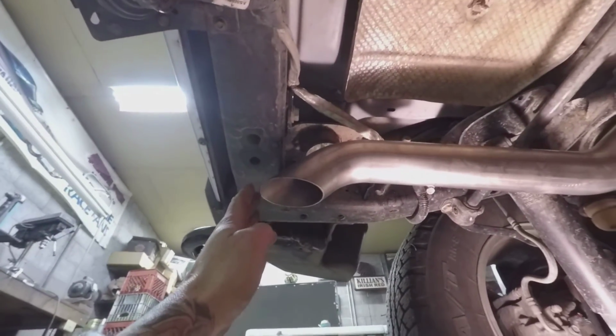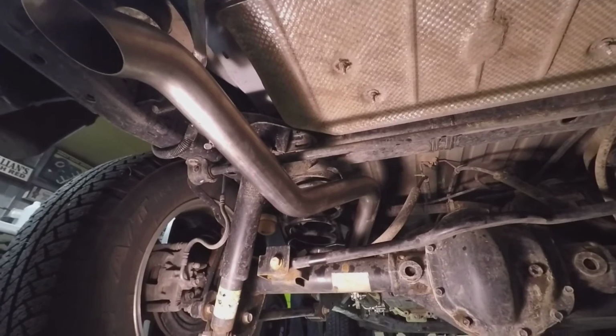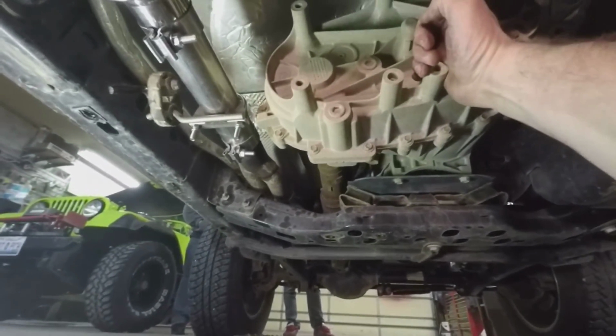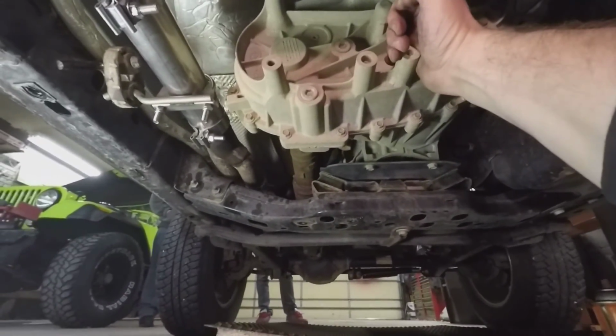Muffler can, tailpipe, coming back, and the tip of the tailpipe is just about center line of this rear cross member. Finished out pretty nice. Hopefully we don't have any rattles. We torqued everything down pretty good. I still have this skid plate for my transfer case out. I'm getting ready to bolt that back in, and then that's going to button up this whole installation.